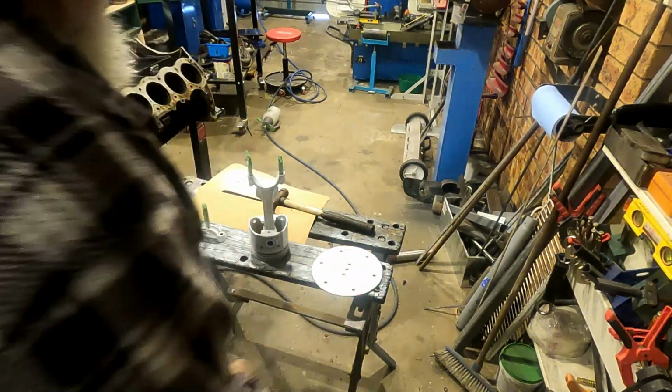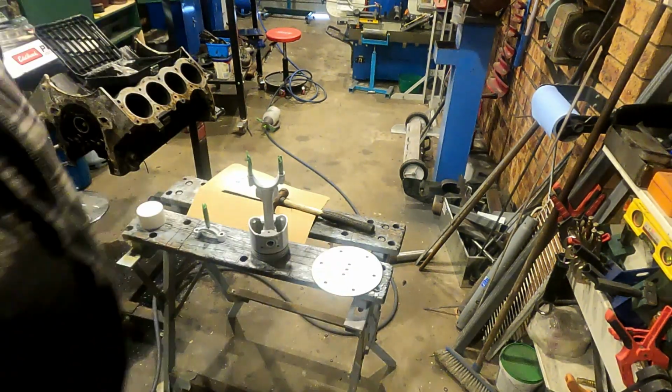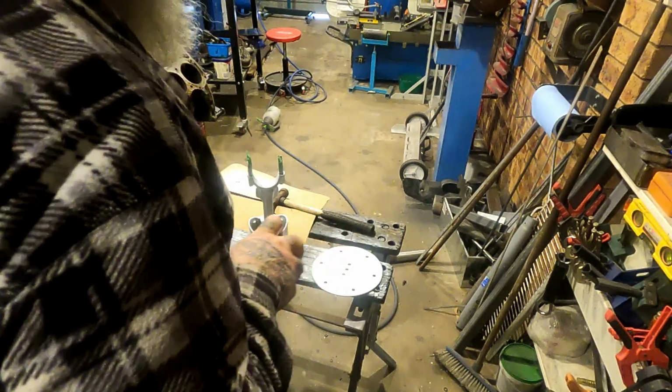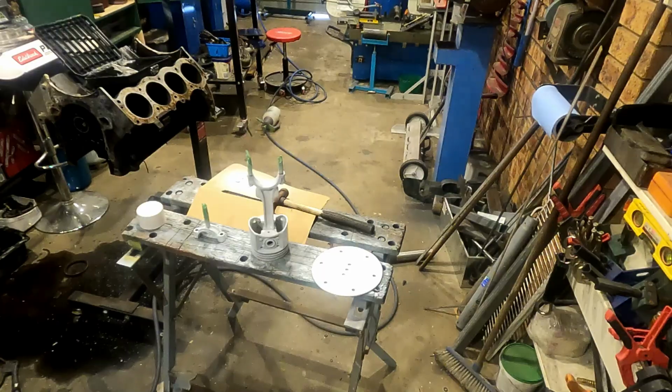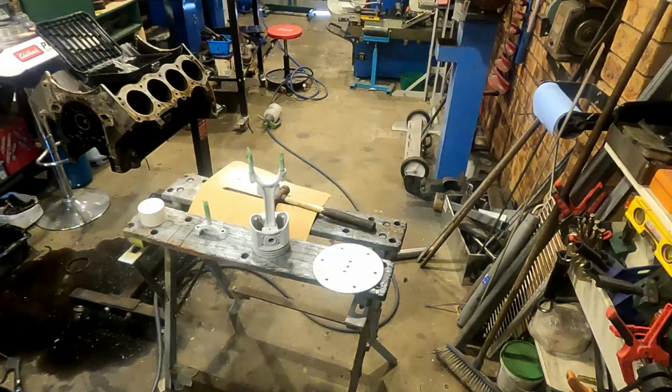So that's dry. That'd be almost dry. It is. That's not. So we just touch up the thing. I'm going to leave them anyway for about an hour. Make sure they're dry. I might start sanding that base. That bog should be set enough now to sand it, and I'll primer that. By the time I prime that, then these will be ready to paint. Stay tuned.